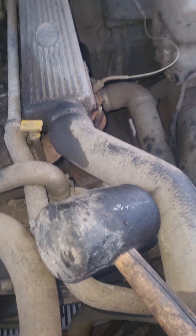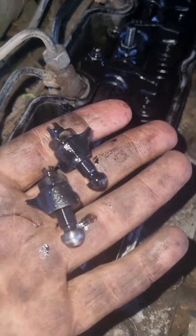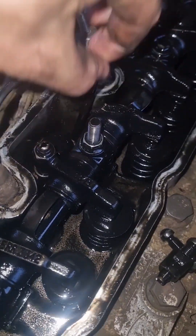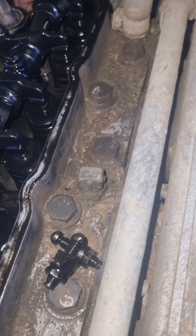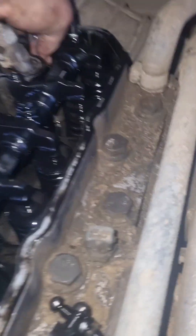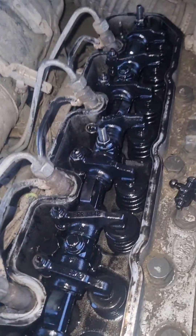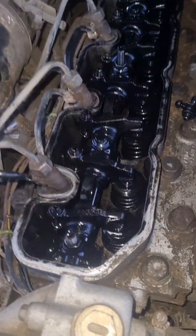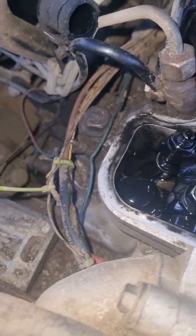So back at James HQ, I've just whipped the rocker cover off for a better look. So far we have two snapped rocker arms and a bent push rod — the very rear one, which is clearly bent. What I'll do is get the whole lot off and then more than likely just whip off the head as you do. Oh what a day.